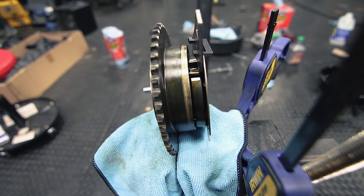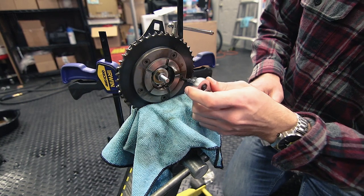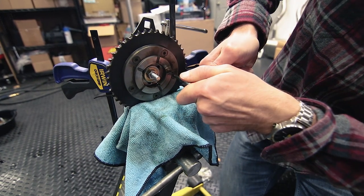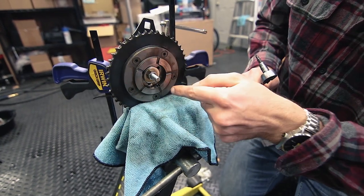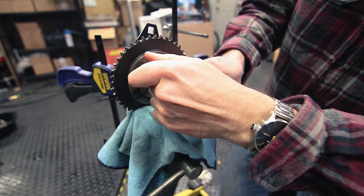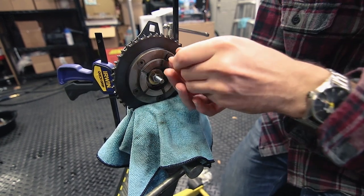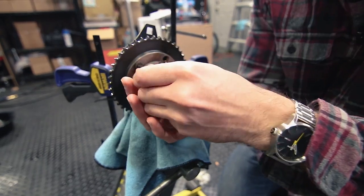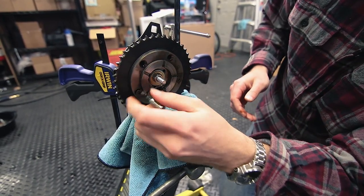So we can start to remove these bolts in the front. Grab a T25 Torx bit and loosen the four o'clock bolt half a turn — not all the way. You do not remove this bolt. That's about a half a turn. Then remove the remaining four bolts. Just remember that this one is special because it is the pin bolt. You'll also notice there's some oil — when we remove it there will be some oil leakage, which is perfectly normal.